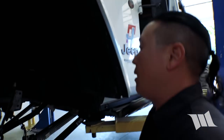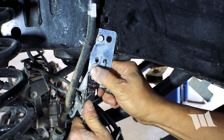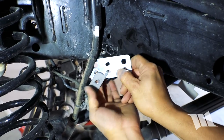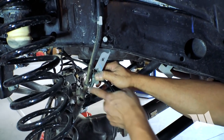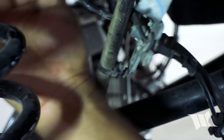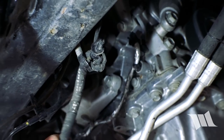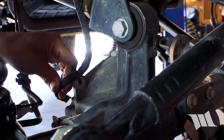Now we can disconnect the brake line relocation bracket we have installed — those are coming off because we're going to install the Dynatrac ones instead. The factory bolt requires a 10mm socket. There are a few Christmas tree mounts securing various wiring to the frame, including the brake line bracket and the breather hose for the axle — you'll want to disconnect a few of these because once you start flexing out, they'll get hung up and become a problem. On the passenger side, I disconnected the FAD wiring from the frame rail as well, and zip-tied it in place to keep it from getting into the coils.